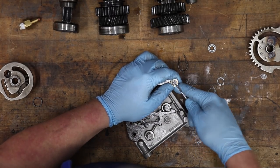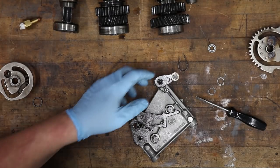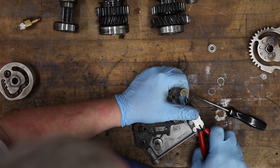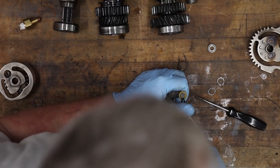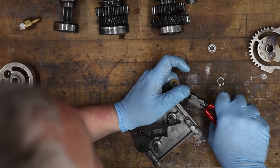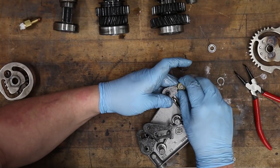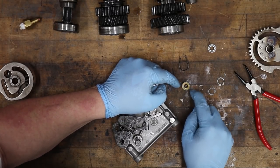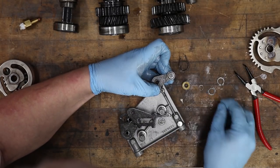Now let's get to this part — it's a weird clip and a difficult one to get snap ring pliers into. Sometimes I use external clip pliers because they'll fit in and spread it with that. It's a little bit tedious but it works — don't spread it any more than you have to. There it goes. If you look carefully you can see it's kind of egg-shaped — the hole's not in the center anymore. It's definitely been holding back the shifting performance of this gearbox. The new ball bearing replacement is a way better part.